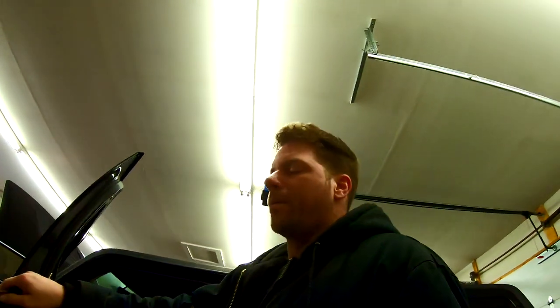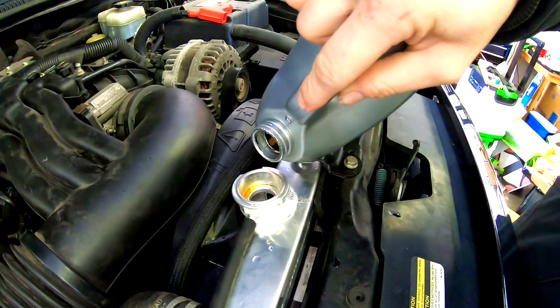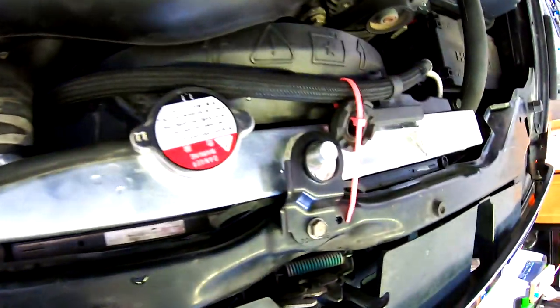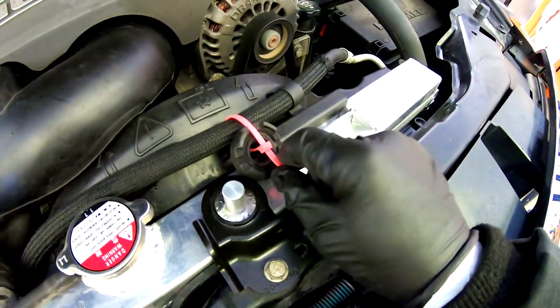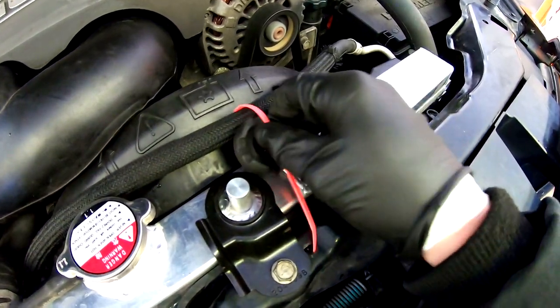For the most part it's all back together, so I'm going to start it up with whatever coolant is in it right now and take a look underneath to see if it leaks any transmission fluid. If it doesn't, I'm going to run to the auto parts store, get some orange coolant, and come back and fill it up. Other than that, it doesn't fit but it worked, so I'm just really hoping it doesn't leak. Let's fire it up and see what happens. That one I was particularly worried about - it doesn't look like it's spraying. I put coolant in the radiator and in the reservoir, both caps still off, getting ready to start up. It doesn't seem to be leaking so far. Good news is I don't see anything leaking. Go ahead and top up the radiator. There it is folks - all-aluminum radiator. Looking good so far.